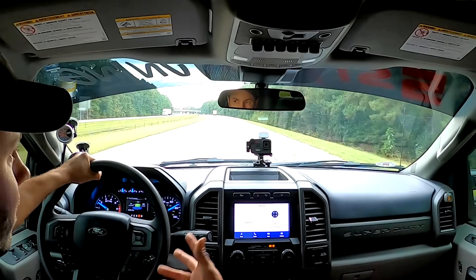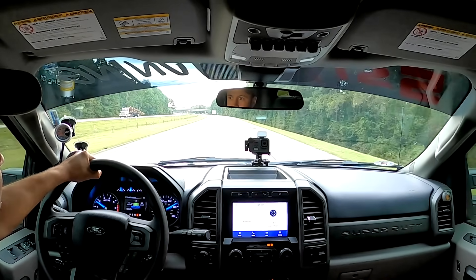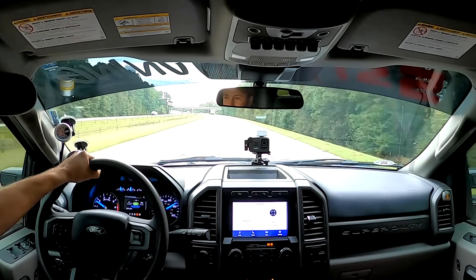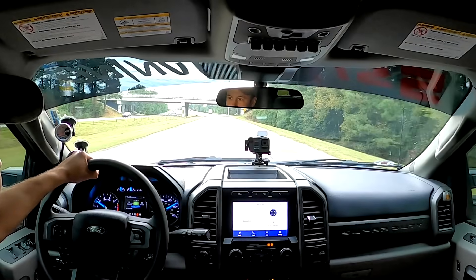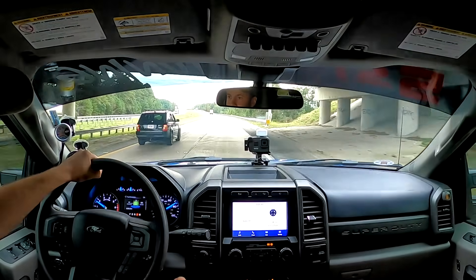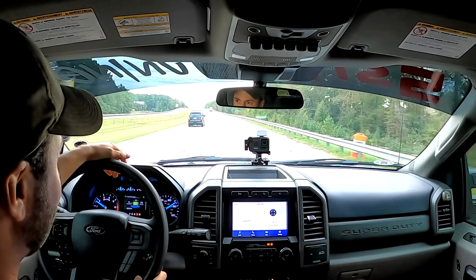The cam itself is a huge lift cam — it just doesn't have a whole lot of duration. When you start throwing boost at it, duration doesn't make a whole lot of difference because you're just cramming air. With a 600-plus lift intake lobe on that cam you can just cram it in even in that short amount of time, and it makes insane power. What I'm really interested in is when we bolt the headers back on and put the 4-inch exhaust back on — I believe we're going to see another 35 horsepower just on the exhaust side, because we saw 20 horsepower just from the headers through the stock muffler.